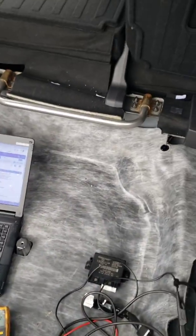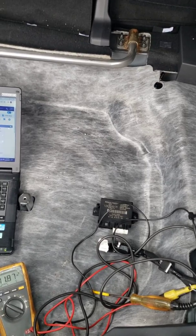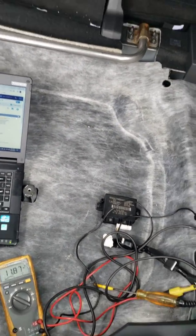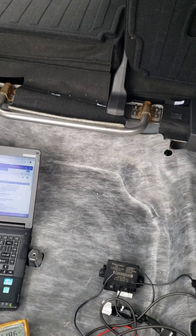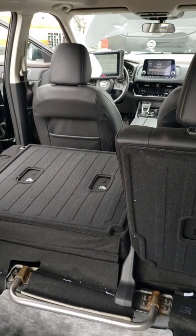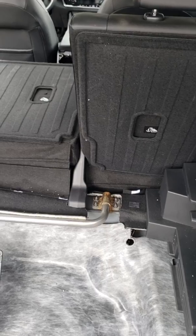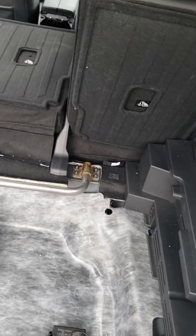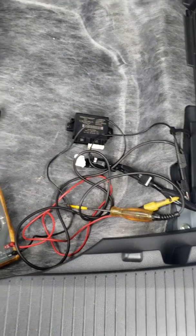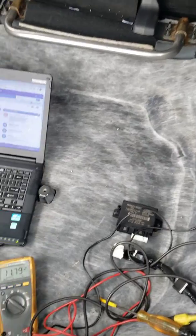Take two — another voltage drop testimonial. I've got a 2021 Nissan Rogue that was a flood car — I know, don't work on flood cars, but I am. It has a bunch of lights for ADAS problems. I do a scan, I got no communication with the sonar module, which is in the back of the car and probably got flooded. All the other modules are ratting it out saying no communication with the sonar module.